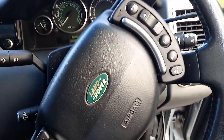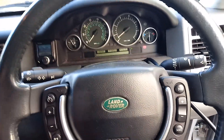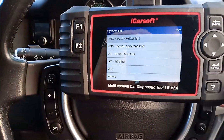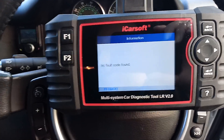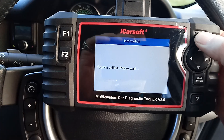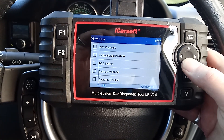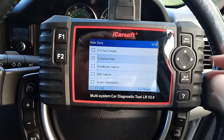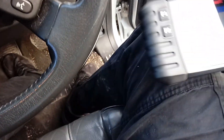Let's move on from the steering. Let's run the steering full tilt one way and then full tilt the other. Not getting any steering angle warnings this time — how bizarre. Let's pop back up and have a quick look in the ABS settings — read fault memory. No steering faults. Could have been just a spurious, minor hiccup somewhere. Let's go back. I wonder if we've got view live data — can we see the steering angle? Yes — steering angle. Let's select that, and there's F2 to start.